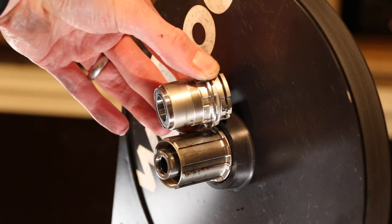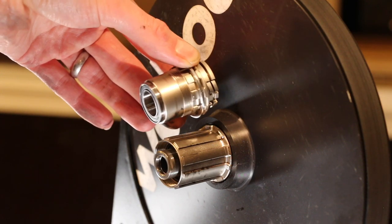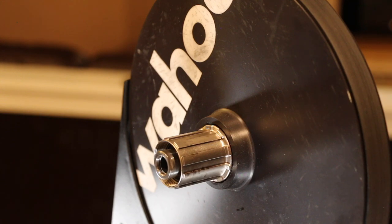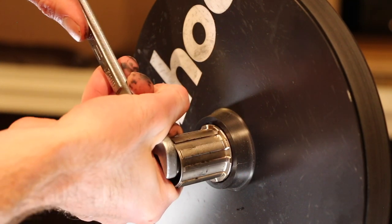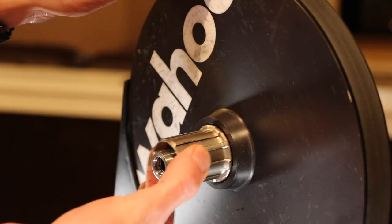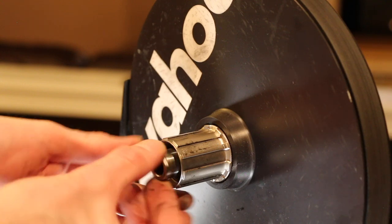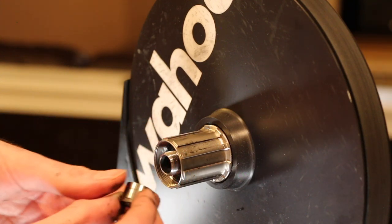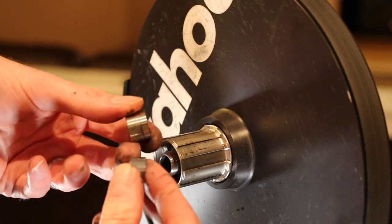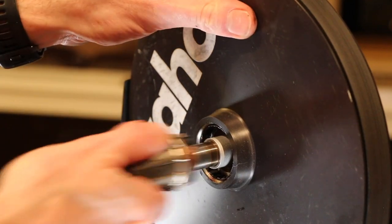This is also a good time to show a comparison of the two different bodies - the bottom is Shimano, the top is the XD, so a slightly different configuration. Anyway, let's use that 17mm wrench and get this guy off. Now that I've loosened this off, I've seen some stuff on Facebook where you get a rattle and people don't know how to fix it - the fix is just to tighten this nut back up. Let's pull the freehub off - it came with an extra nut, but I'll probably go with the new one. It's a little shorter, so there's probably a reason for that.